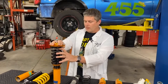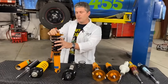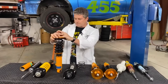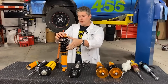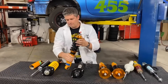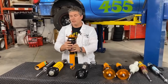The handling will be the same. You can sort of do a thought experiment: what if we had two identical shocks and one of them was allowed to extend much further than the other one? If it had a much longer shaft at ride height, you'd never be able to tell. Everything would work exactly the same until the spring fully extended, and then you'd have all that extra shaft travel on the other shock. The actual preload would be radically different, but the actual ride quality, the ride height, everything else would be identical. So spring preload is not a thing when it comes to suspension tuning, unless you get into really extreme cases where the preload is greater than the weight of the car, in which case you're really screwed up.